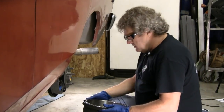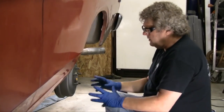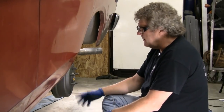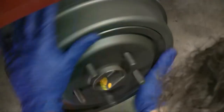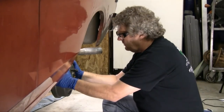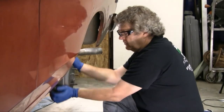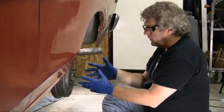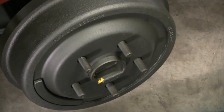I'm going to put this on and see what we got here. It's perfect because it's loose — you'll have to go in and do an adjustment with the adjuster on the backside of the drum, but this looks really good. We got a good even lay across all of it. Once the wheel gets on there it'll pull it into position. As I spin it, I don't hear anything that sounds like I've got a warped drum or the shoes are not sitting in the right place. So that's good to go.